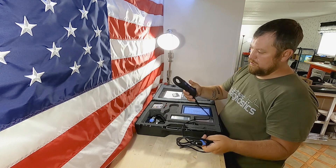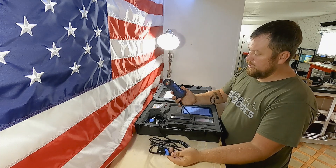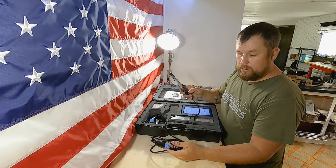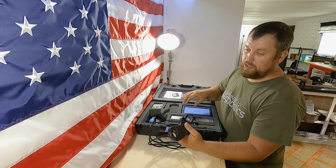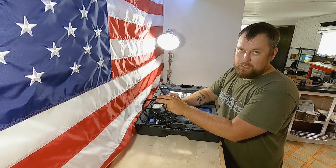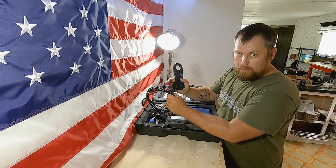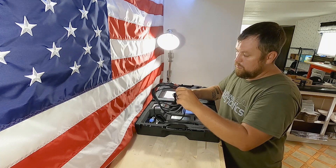It comes with your high amp clamp. If you notice on the high amp clamps now, they're not as big, not as bulky, whole lot thinner. The reason for that is your scope powers them. Anybody that's done scope testing knows — is my nine-volt battery charged? Did I leave my meter on? Now these are powered internally. No more dead batteries.